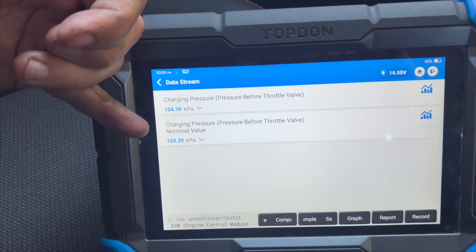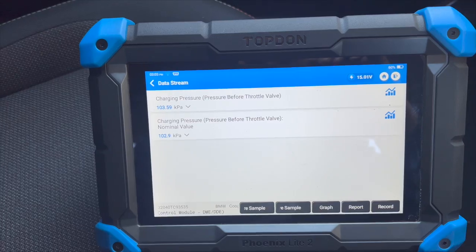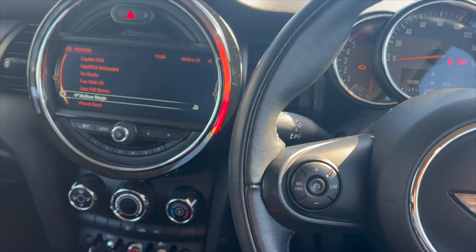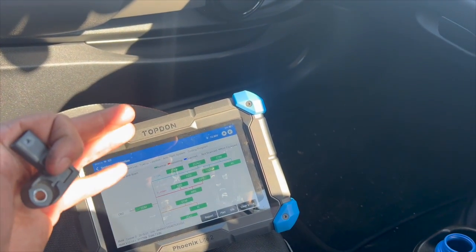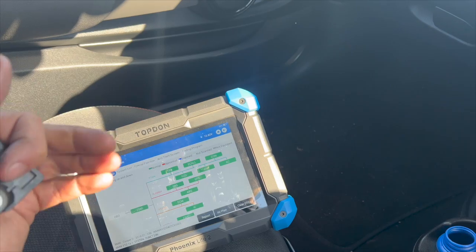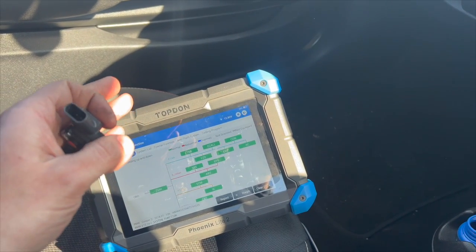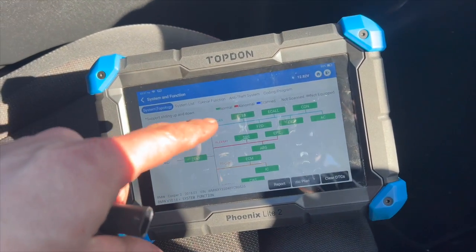You can see we're getting a lot of different readings now. So just going to give it a quick run to make sure the fault light stays out. We've just got back from the road test — done about five miles in it — it's ran absolutely spot on, boosting perfectly all the time now. When we cleared the fault codes before, the very first time you tried to let it boost it would start trying then just shut down into limp mode. I did check the wiring feeds earlier — all the feeds and crank feeds were there — so we knew it wasn't a supply issue. It's just the actual reading that the sensor was giving out that it didn't like and why it was shutting it down.